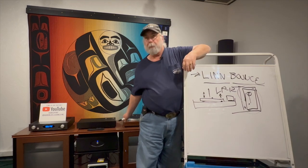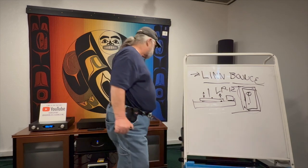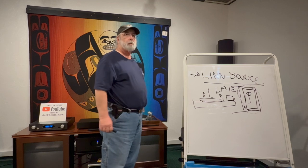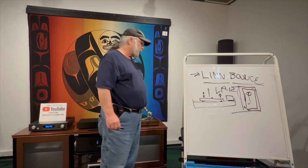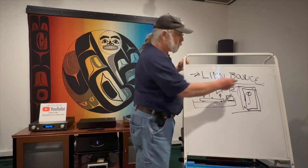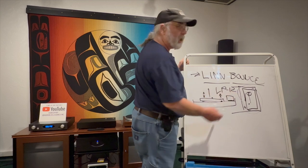And that's in fact what happened with this turntable. Being 25 years old, I decided to change the grommets because they were dried out. And also, I went with a newer set of springs, and it just locked in dead. It was really amazing. So this is what you want to first look at, is what's happening.